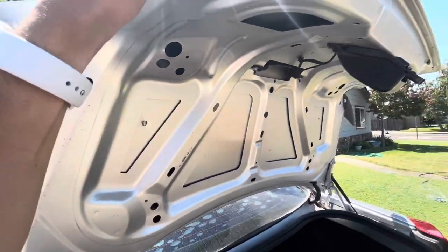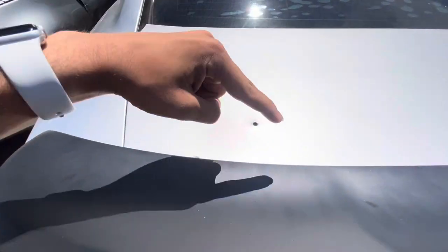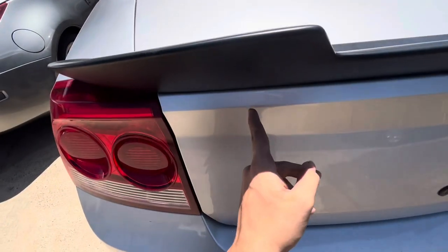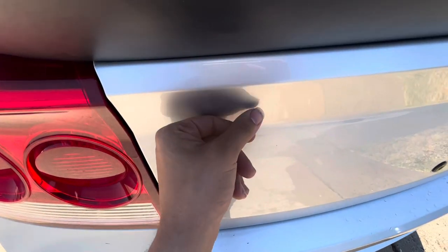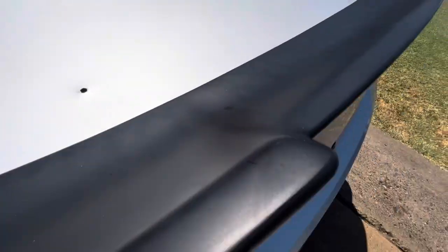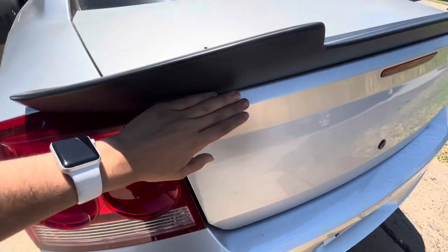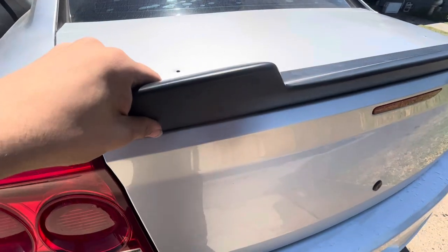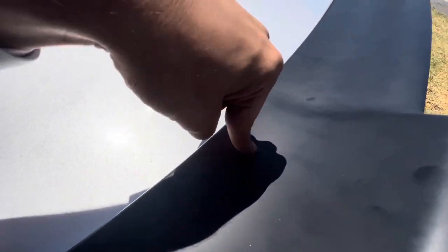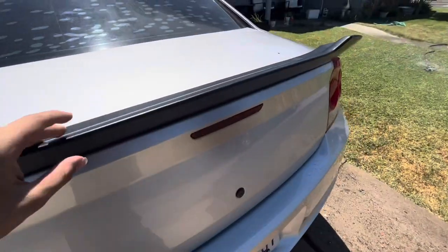You'll know exactly where your thing goes. Line them up on the trunk, then you poke your holes through so that way your holes that are taped to your spoiler are poked out. You'll lay your duckbill down, and you're going to take those strips of cardboard that lay out from your hole — mark it and it'll come down about two inches on each side. Super-tape that to your trunk and to your bumper, so that when you disconnect it from the duckbill, it doesn't rip your template. Take your duckbill off and the cardboard should still be taped to your car — that hole right there is your center hole where you need to drill through your trunk.